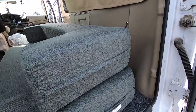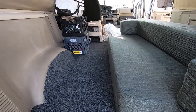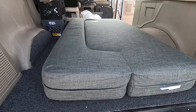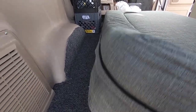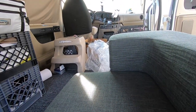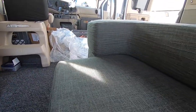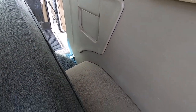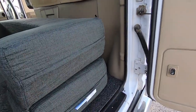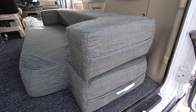Here it is. I'm going to build a frame — it'll sit up over top of the fender well. It's in the couch form right now. You flip it over and it's a bed. The cover's soft and washable. I'm going to rest the board right on top of the fender well — that'll determine height. Any higher than that my head hits the roof. So the frame will be 9 inches. This thing is 10 inches thick, which makes it 19 inches off the deck — about as much as I can go.